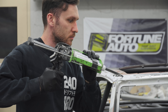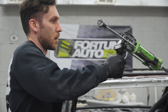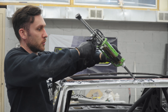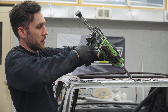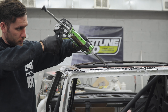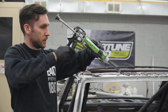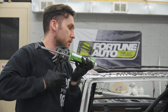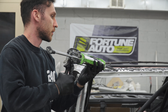It's primarily an adhesive to glue the two pieces together, but it's a mechanical bond, not an actual adhesive bond - so that's why you need to make sure the surface is scratched, which is why we have the inside of the roof scratched as well. The second reason for covering everything is it's not going to rust if all the bare metal is covered. That's why you want to make sure you don't have any bare metal exposed, because we really hate rust.